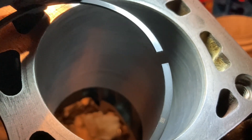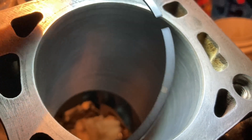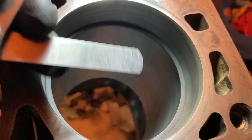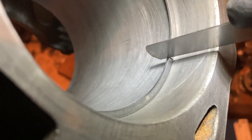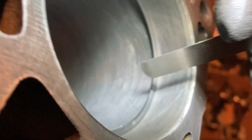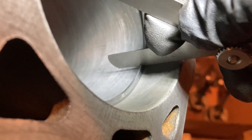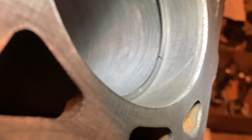Your second ring is typically always a bigger gap than your first ring. We'll put this in the bore and see what the gap is. Starting at 25 thou — that won't even go in there. Going down — even 22 thou is snug. We definitely have to open that up and get it up to about the 29-thou range.